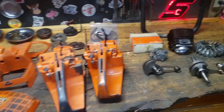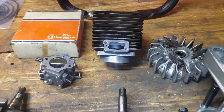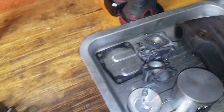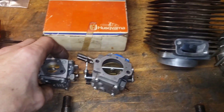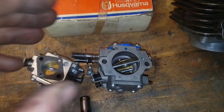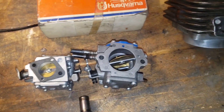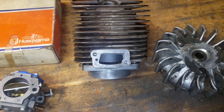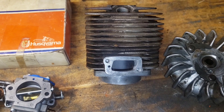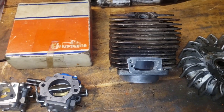I plan on doing a two-piece head, and I don't like this intake — I really don't. So we're getting rid of the stock carburetor. I want to put this 3120 carb — this is off the 3120 Husky — quite a bit bigger, and that intake on the cylinder is going to be a choke point. I might just do a separate impulse line and reshape that intake altogether.